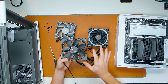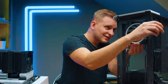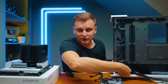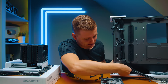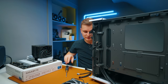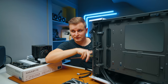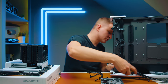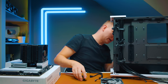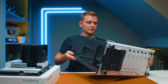The stock case fans do go to 1700 RPM so they're slightly faster than usual, but we're going for something more premium. One thing to note: these fans mount on a bracket in front of the fan position, so you're screwing in from behind rather than from the front. With three 120mm fans across the front you'll have to screw in the last ones from behind — it's doable but slightly harder than usual cases, so it might be easier to install the motherboard first.